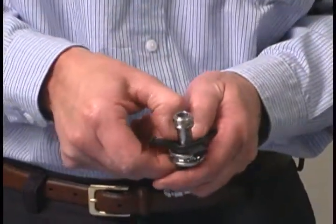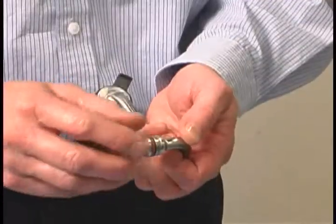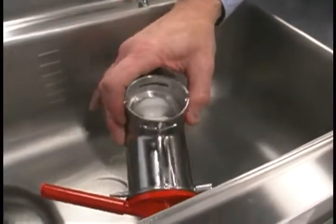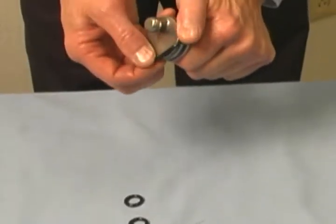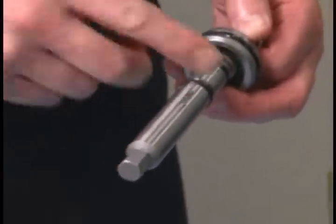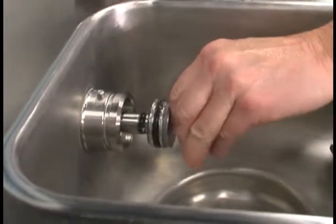Assemble the feed tube assembly. Slide the check ring into the groove of the feed tube. Install one red O-ring on each end of the mix feed tube. Lubricate the O-rings thoroughly. Lay the pump assembly, the pump clip, and the mix feed tube in the bottom of the mix hopper for sanitizing. Slide the large black O-ring and the two smaller black O-rings into the grooves on the drive shaft. Thoroughly lubricate the O-rings and shaft. Do not lubricate the hex end of the shaft. Install the hex end of the drive shaft into the drive hub at the rear wall of the mix hopper. Repeat these steps for the other side of the machine.